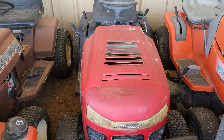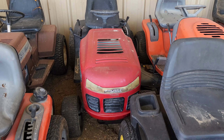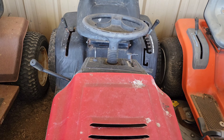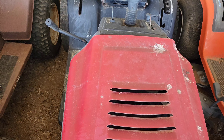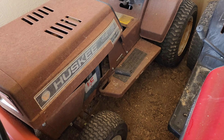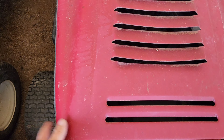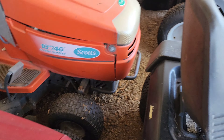This one next to it — I don't know what year because the tag is worn off, but it's either 04 or 05, the only years they had this hood. It's a Murray Performance Garden Tractor with a Briggs V-Twin — I think 20 or 21 horsepower. I got it in Shreveport; I think he said he swapped this motor in because the old one threw a rod. It doesn't have a deck, but it's got a 6-speed Peerless 820 transaxle with one-inch axles. I've been wanting one of this style of Murray for a long time. I've got another hood sitting over there that I bought a long time ago in Arkansas.